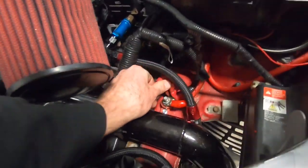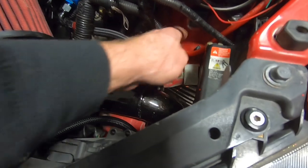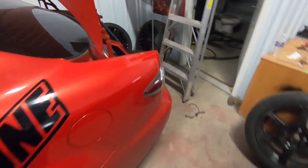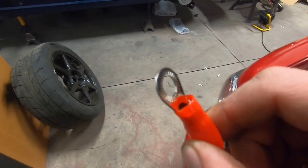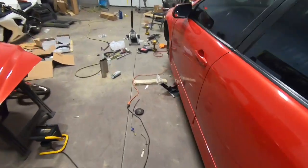And basically what we did so far is we mounted this terminal post down here and we got the power wire for the stock harness and the battery relocate wire all hooked up here, run to the back where we have the battery. And there's not much light in here, we have a 100 amp fuse in here with the power wire. I'm gonna mount that, but basically battery hookup will go here, and then ground here to the chassis. The issue right now is that all I have are these little ring terminals. I need the actual battery terminals to make that work.